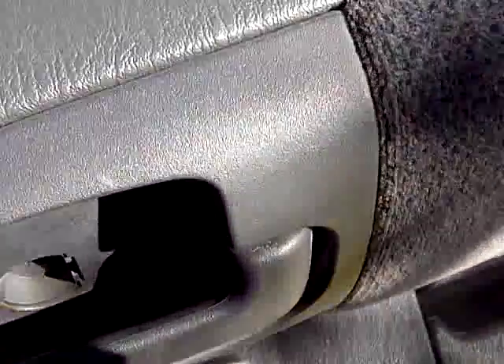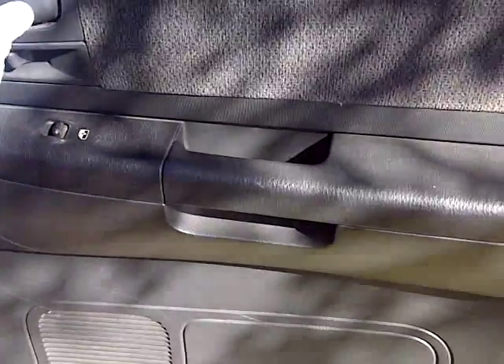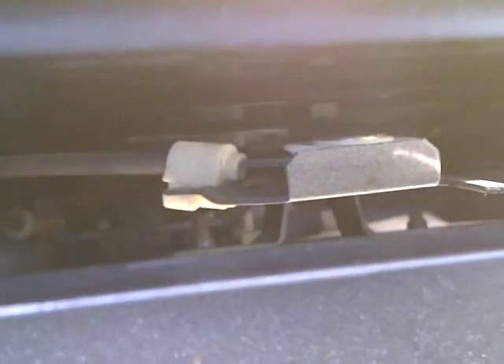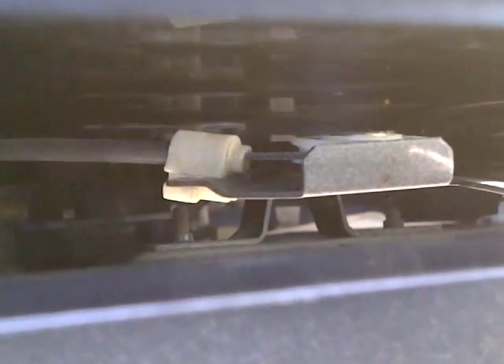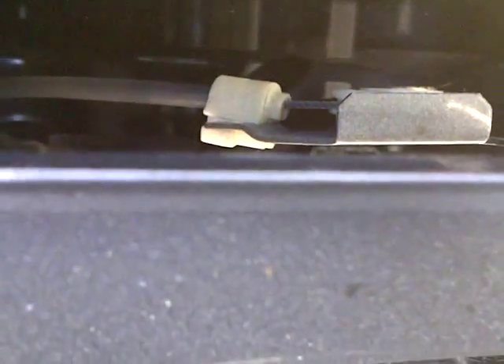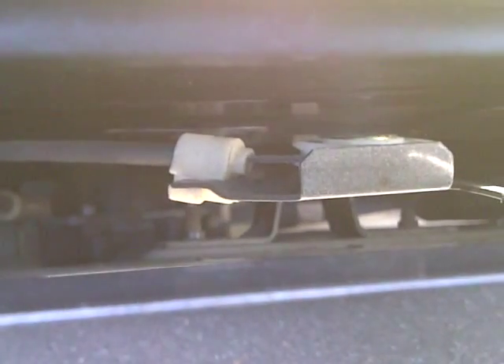Okay everyone, I'm back. I went to the other side of the door — I was having some issues with the lock anyway, so I wanted to see what's behind there. I can see the wire connected to the pulley right there on the regulator. Well, on mine it's broken. That's probably why it's not working. That's the problem — I'm going to have to probably get a new regulator or something like that and put it in.